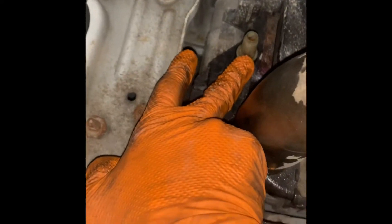So we've drained the coolant out, drained our oil, and our gearbox oil as well. Just taking off our clamps for the exhaust. Now we can look at the rear engine mount — take it off. Then we're going to get the wheels off and start pulling the drive shafts out.